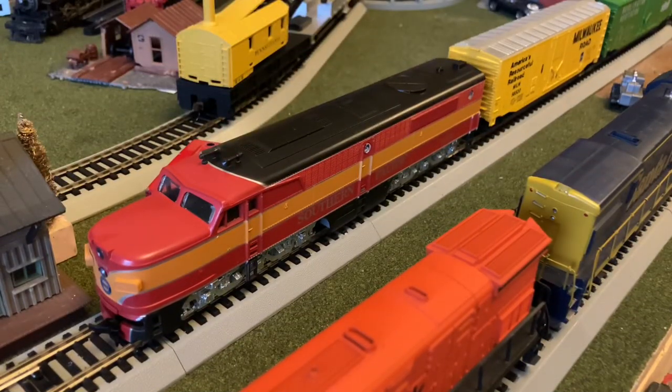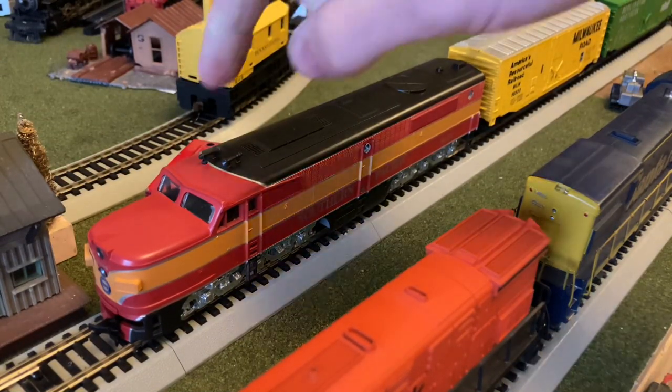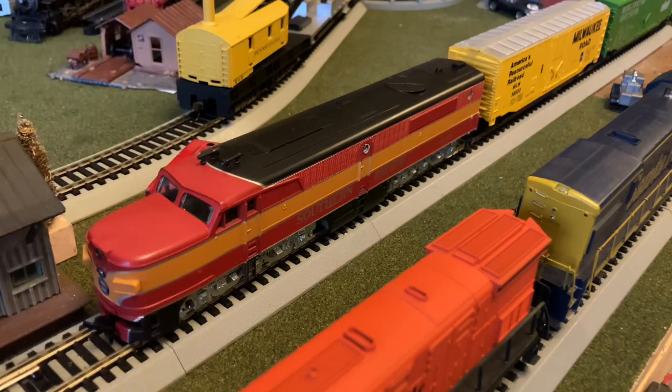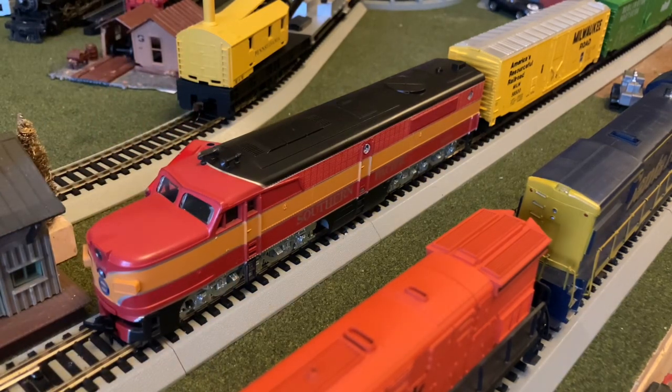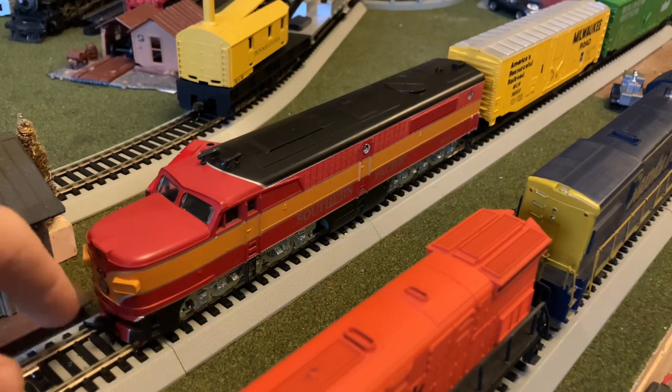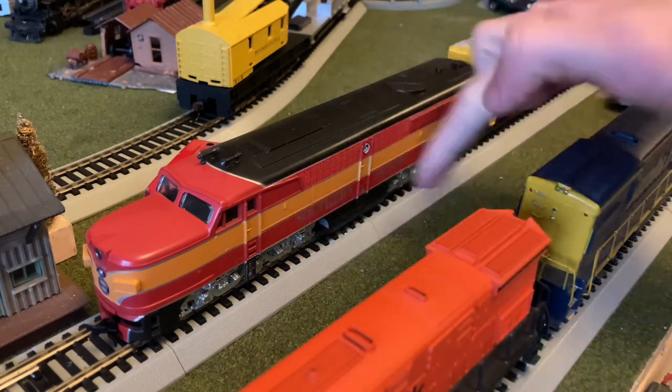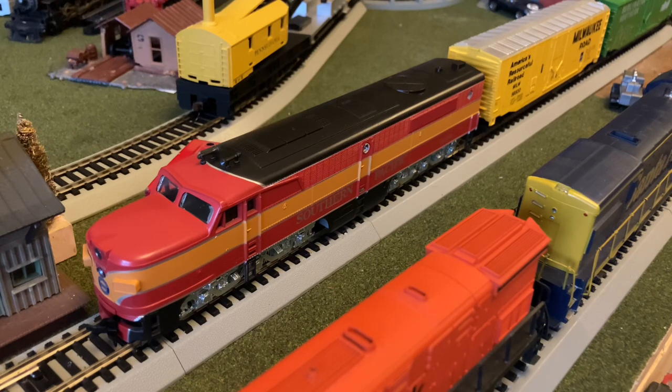Now we're at the conclusion of this restoration video. We glued down the horns and windows, cleaned up and refilled the lubricant inside, and put the two couplers on, even though they were kind of hard to do on the front side. The rest was standard: cleaning the wheels and the commutator. Aside from that, this engine is running a lot better, smoother and more efficiently. Thanks for watching, and I'll see you guys next time. Bye bye!